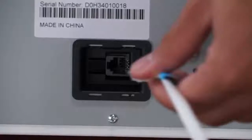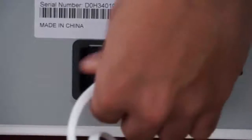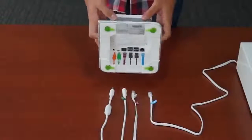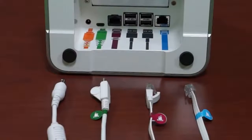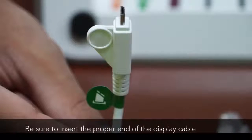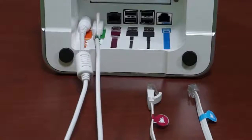We'll start by connecting the cash drawer cable to the bottom of the cash drawer, then setting it to the side. Now we'll connect all the cords to the receipt printer — it's very important to do this before plugging it into a power outlet. Flip the printer so the bottom faces you. Starting at the far left, we'll insert the power cord first. Next is the display cable. It's important that you do not plug the wrong end into the printer. The end with the finger hold and green sticker with the printer icon goes into the port. We'll plug the other end into the display later.